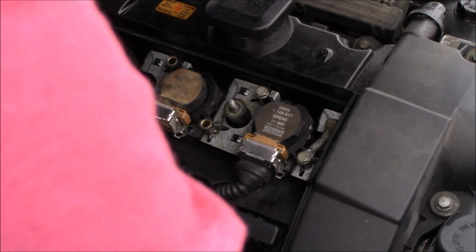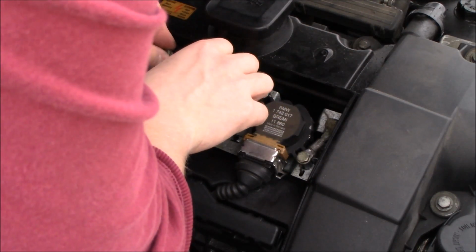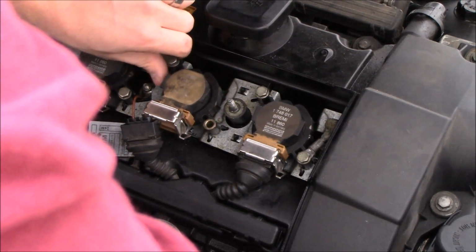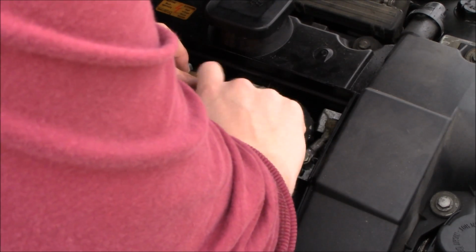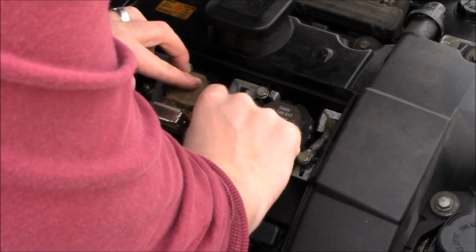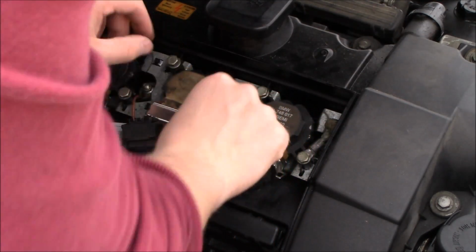So as I was mentioning before, if you are having this problem, maybe check all of your air intake connections, see if there's anything letting extra air come by or leak. And as I said before, I am going to be putting together some videos of various spots that I checked and replaced and tried to seal up some air intake leaks.